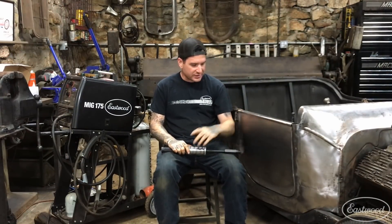So there you have it. Pretty quickly I was able to rough out two big dents that were in the car using the MiG stud kit. The kit works really well for pulling out dents, but the other thing I like about this tool is it saves space. A normal traditional style stud welder is a big, bulky gun that's difficult to use because of its size and a pain to store.